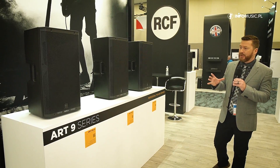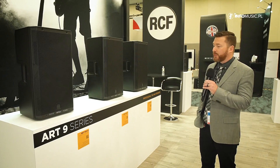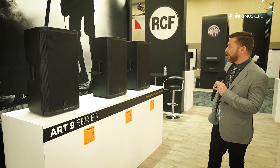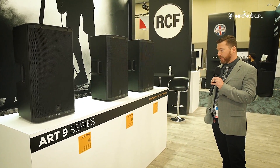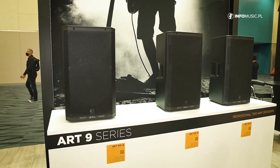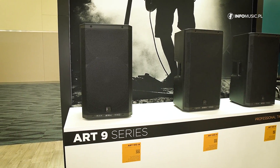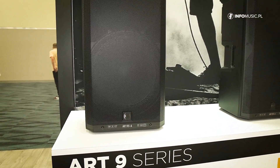Internally, we've increased the amp size, coming from a 700-watt RMS amplifier up to a 900-watt RMS amplifier. We have redone the FIR phase filtering algorithms for improved high-frequency phase response, and now introduced bass motion control, measuring the excursion of the low-frequency driver, eliminating the need for a high-pass filter, which is going to increase the intelligibility of the low-frequency response.